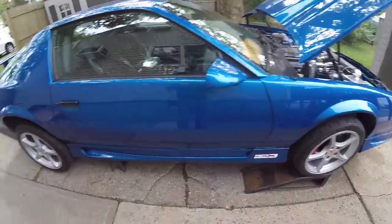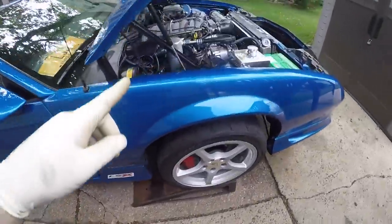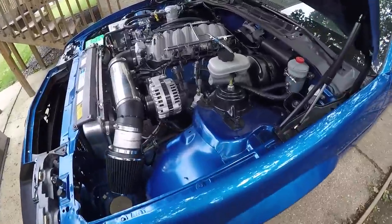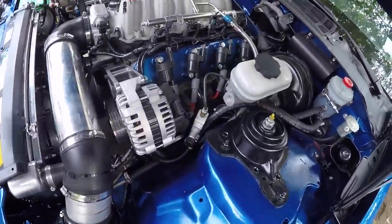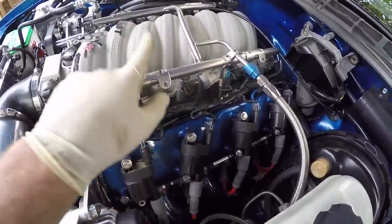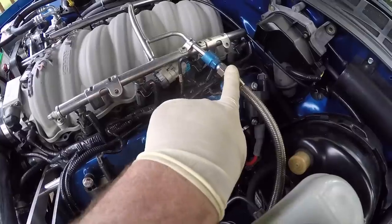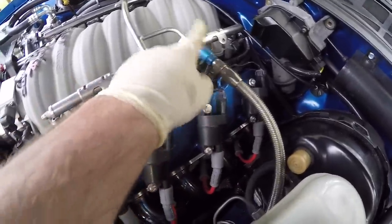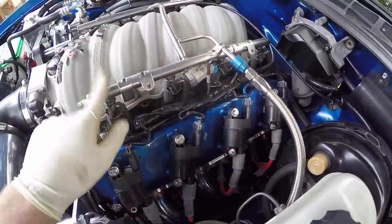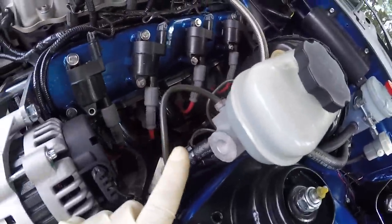The car is in the air and I'm about ready to get working on the fuel pump. First I'm going to give you guys a tour of my current fuel system and how I hooked it up when I first did this LS swap. I'll start up here and work my way back. With the FAST setup I'm using an LS3 rail. The truck rails do have a return, but when I first did the swap I was using an LS6 intake with an LS1 rail.